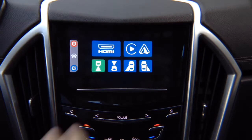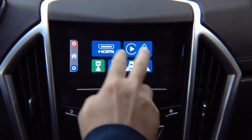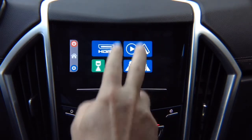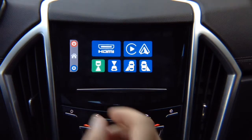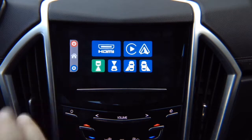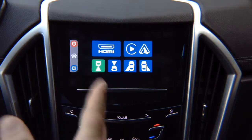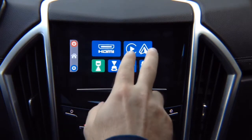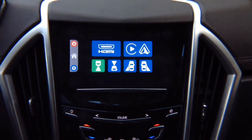If your vehicle is equipped with factory Apple CarPlay and Android Auto, you don't have to worry — your factory Apple CarPlay and Android Auto will work as before. This is an optional module. If your vehicle has that from factory, you don't have to purchase it — you will continue to use your factory Apple CarPlay and Android Auto. This interface is compatible with all IO5 and IO6 navigation and non-navigation vehicles, starting from 2013 all the way to 2019 with GMC IntelliLink, Chevrolet MyLink, Buick IntelliLink, and Cadillac CUE. The Apple CarPlay and Android Auto module is optional — if you just want mirroring plus four cameras, you don't have to purchase it.